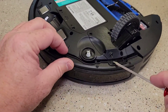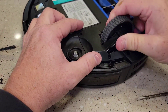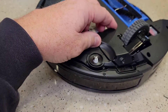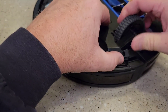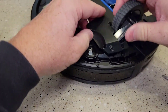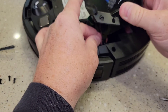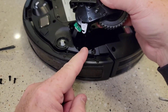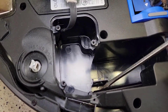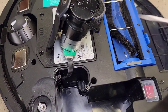So you've got to kind of pry it up — that's a sensor, so be careful right there. It doesn't want to come out, but it can come out. There's a spring we're going to disconnect. Once you pry it up just a little bit, you're going to hear a spring that's keeping it. Then there are these little tabs, so it should pry up. Now there's a spring right there — don't break that. We just need to disconnect that spring. There's a hook — see that hook — that's what that spring connects to. So don't break that tab. There is an electrical connection here, and that spring connects right there.